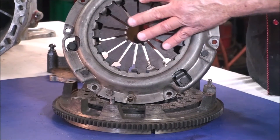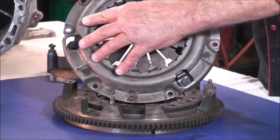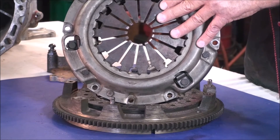There could also be an issue with a broken clutch pressure plate spring or a diaphragm spring. When that happens, the clutch pedal feels strange — soft and weird — and it doesn't work correctly. The spring of the pressure plate can actually break. You can't see the break, but it'll break down in here and will not apply correct pressure to the clutch assembly.